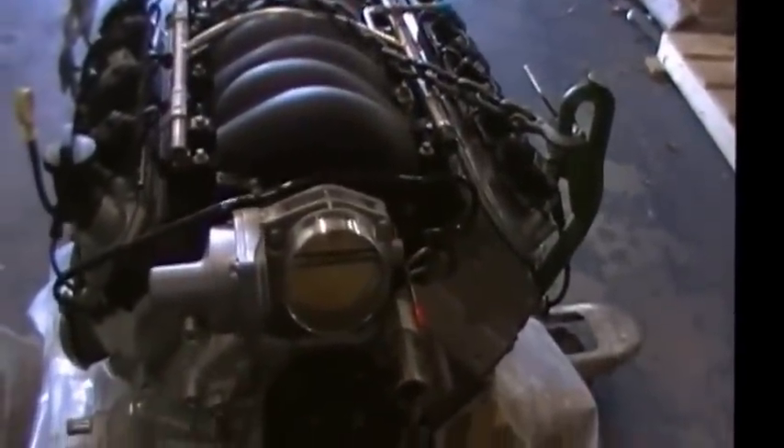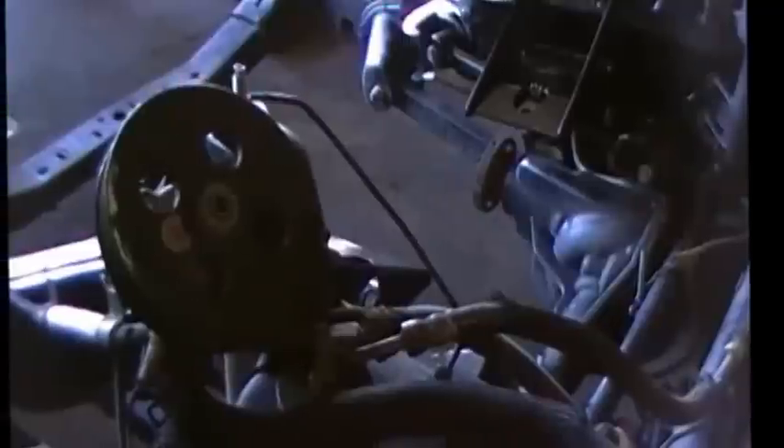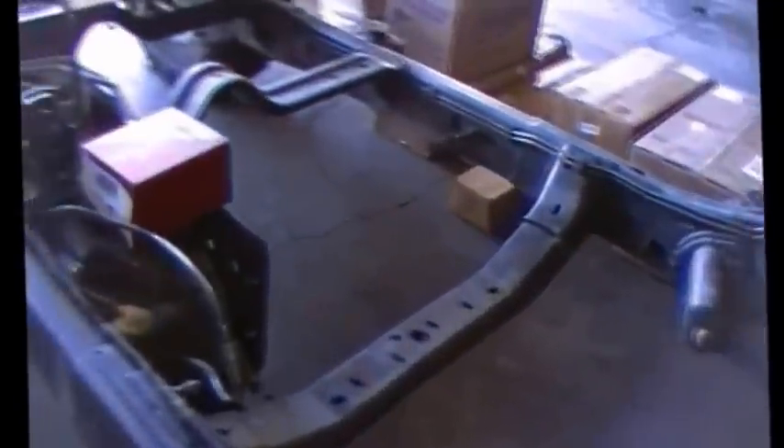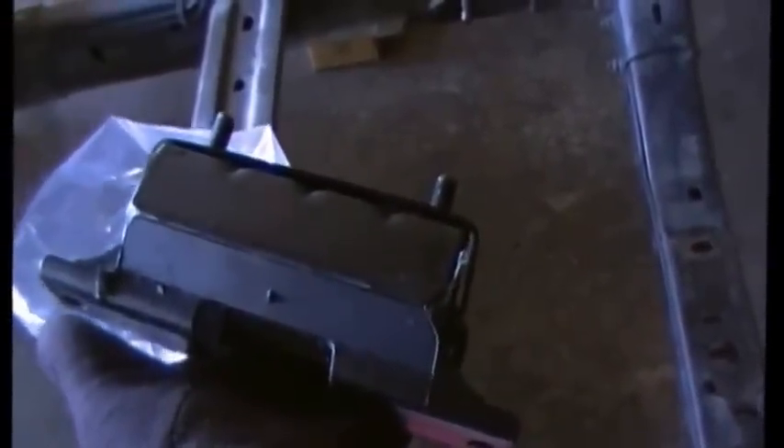Let's go back and look at some of the bracketry for this engine. The guy's got most of the parts laid out — here's his old parts in these bins, there's his new radiator we'll be installing. He's going to modify that fan shroud. Engine mounts are in, you'll notice the power steering pump is still on the vehicle and has not been taken off — no power steering fluid has been lost. Same thing with the brake system. Here's some parts we're going to go over. This is a transmission mount — use a heavy-duty four-wheel drive Chevy truck transmission mount.